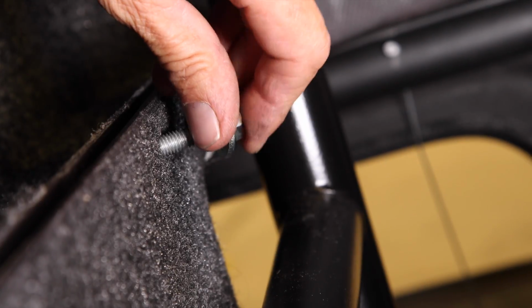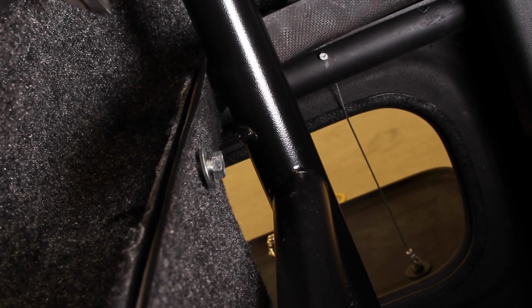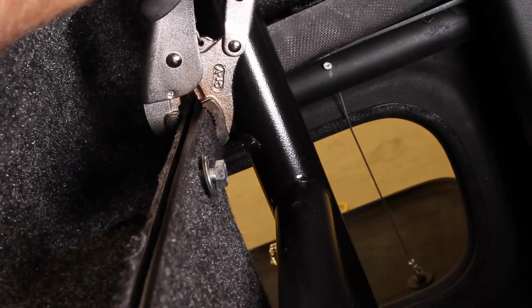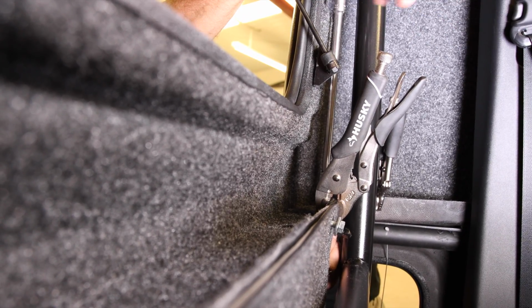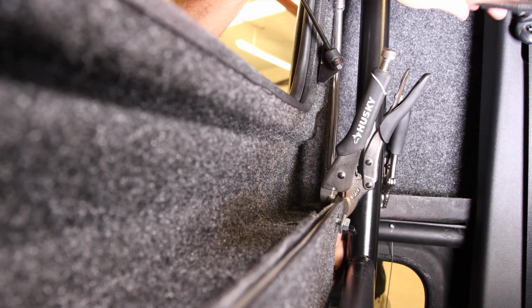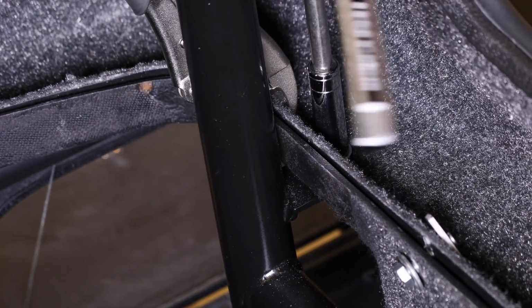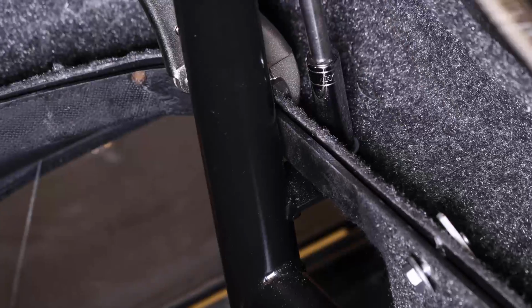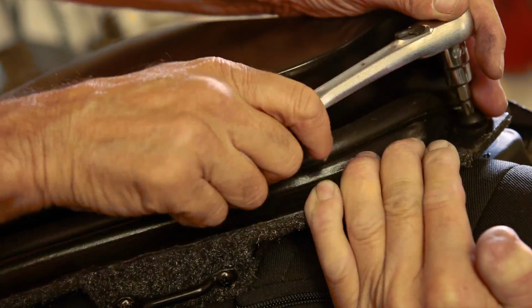It will be necessary to use vice grips or even a C-clamp to squeeze the hardtop and the truck bed together to aid in bolt installation. When all the bolts are started and in place, tighten them each up a little at a time just to pull the two sections together without damage. Go ahead and final tighten all 7 bolts as well as those upper hardtop bolts.